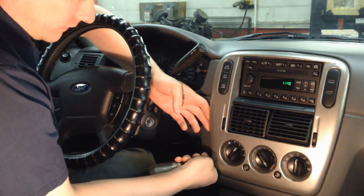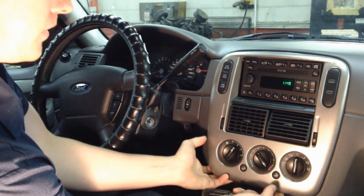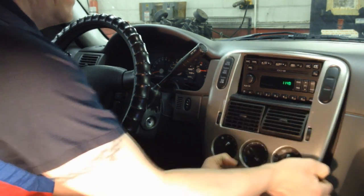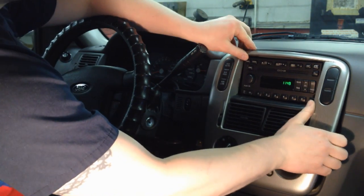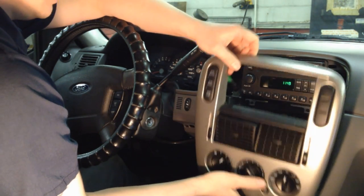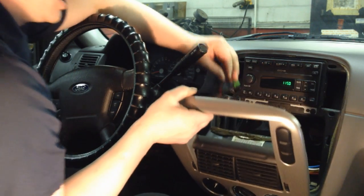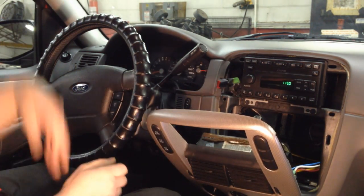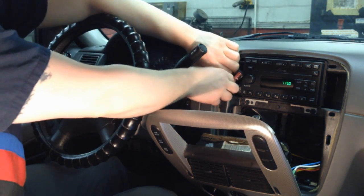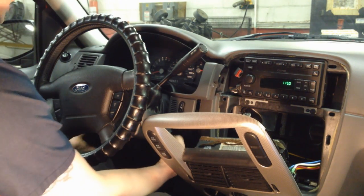There's one down here again — pry off your fingers instead. Once you get part of it out like that, it's going to start coming out a lot easier. Use your fingers, work your way around — the plastic's pretty strong, just take your time. Then this can simply go to the side. I'm going to disconnect this 4x4 switch so you can see a little better. Here's the part that got overlaid — it has a push retainer that goes into the dash too, so you just yank on this and it'll pop out. The rest of the retainers holding this piece in are pretty weak.